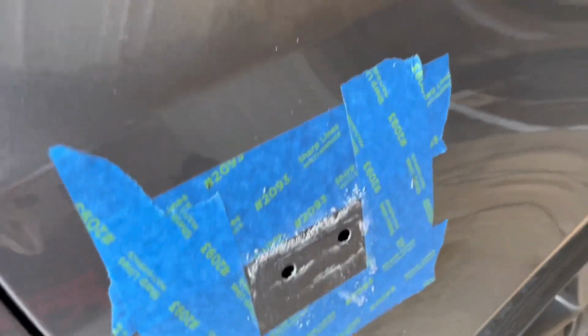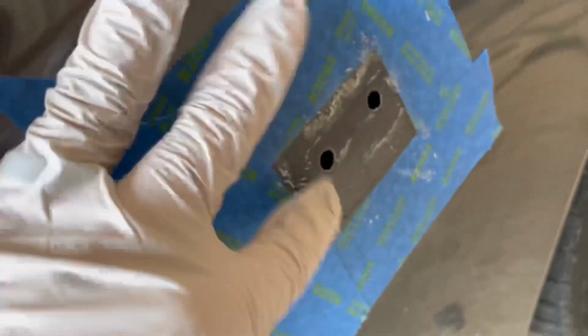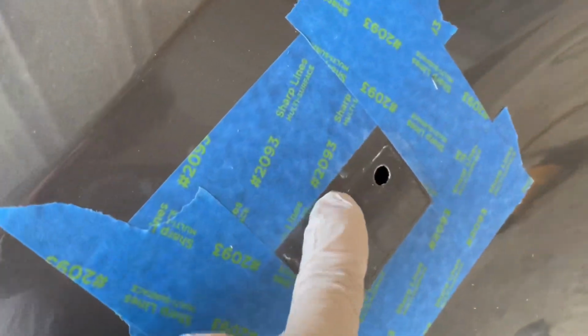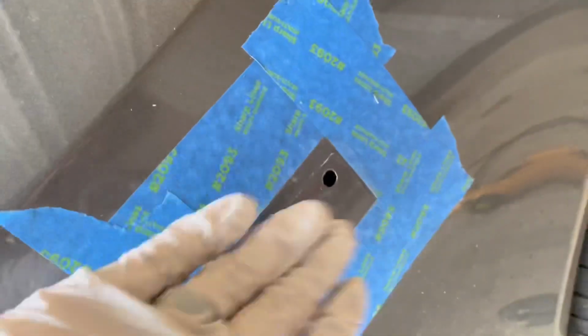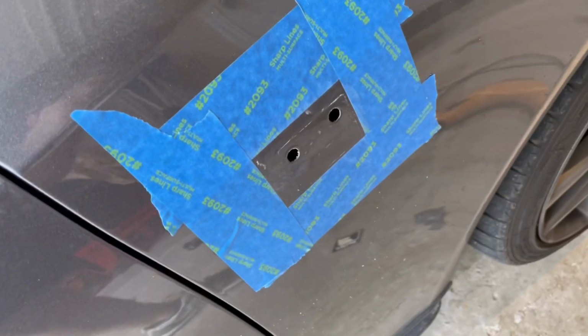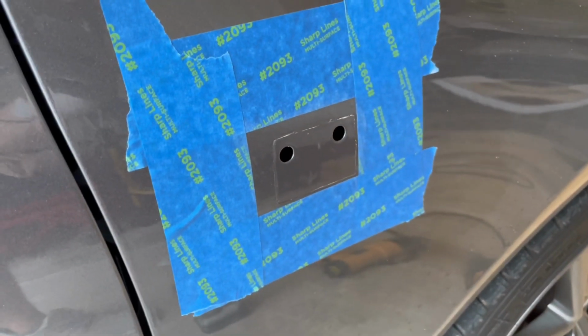And then once you got mostly all the adhesive off, it should look like this. This is all eraser dust, so give it a good wipe down with your hand. These are the two holes I was talking about. You actually see the original outline for where the first emblem went. So once you give it a nice hand wipe and you take your tool to it a couple times to get the adhesive off, you can go ahead and wipe it down with your wet microfiber again, and you should have a pretty clean surface. Right, and this is how it looks once it's all wiped down.